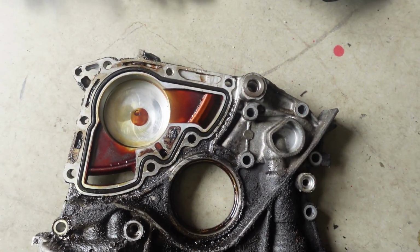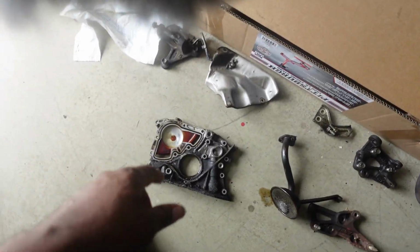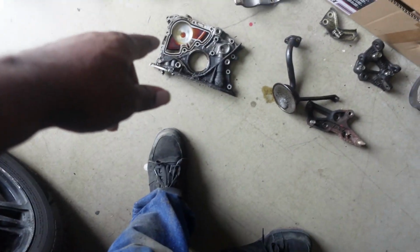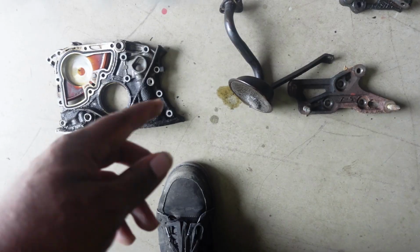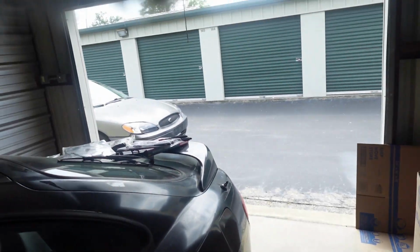All right, guys, so the oil pump housing is off. I ended up taking this out as well. This did actually fly when I was trying to take this guy off. But like I said, you do have to drop the oil pan in order for this assembly to come out, as well as take off those two, well, technically three, 10 millimeter bolts for the pickup tube. I'm gonna take that home with me as well to clean it. So I'm gonna go ahead and pack everything up, load it onto the car, and hopefully I'll see you guys next week. So ta-ta.